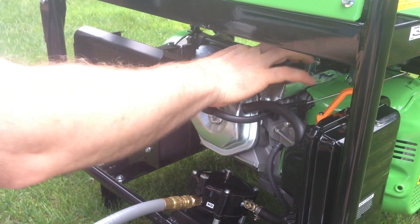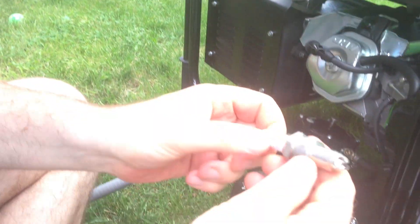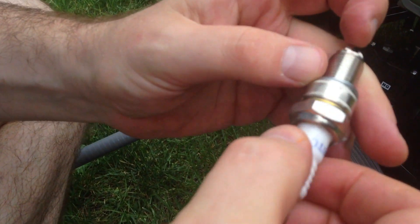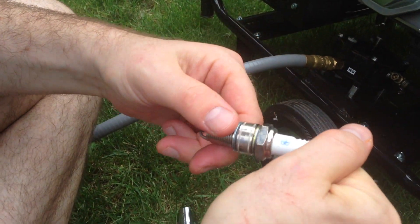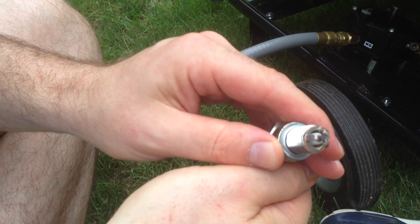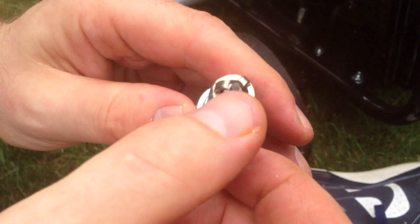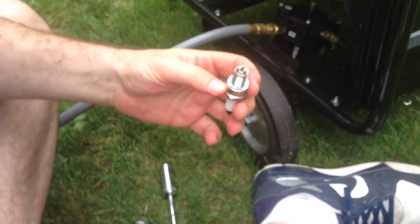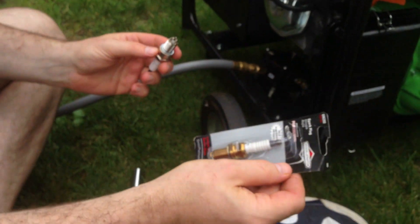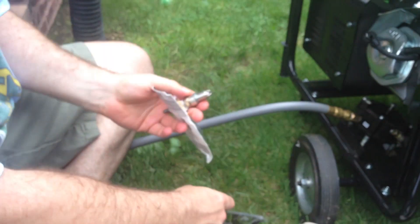Okay, this is the spark plug. It says F6TC on it. Look at the spark plug here — it's a triple head design. That's interesting, I wasn't expecting that. Maybe it's a good spark plug. It's actually pretty clean, which on natural gas it usually is. So what we'll do is take a look at what kind of spark this produces, then take a look at the Briggs & Stratton Platinum spark plug which has one head, and then the E3 which has two heads. Maybe the original with three heads is better — I don't know.